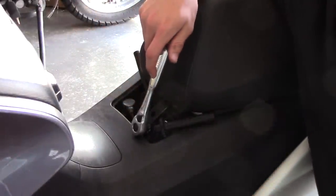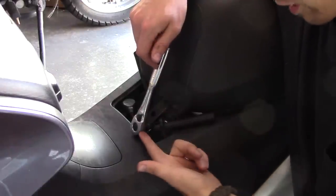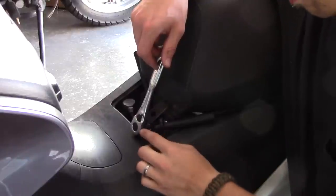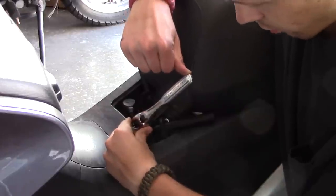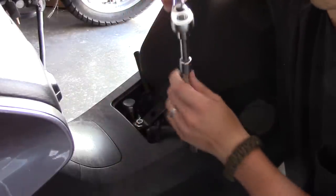When you get to that final tightening stage, a good way to do it is set your ratchet straight up and down. A quarter turn would be 90 degrees, and an eighth turn is 45 degrees. Just twist your ratchet halfway between the two positions, and there you go — one-eighth turn.